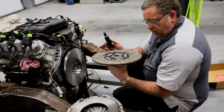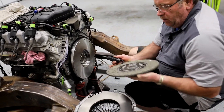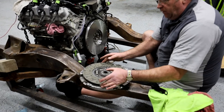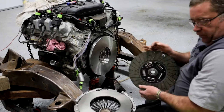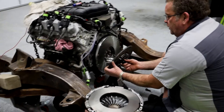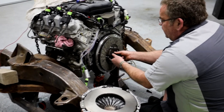This particular clutch does not have a marking. We can see that this clutch will fit in the pressure plate but will not fit in the flywheel. So we know that it has to go this direction. Typically that's the direction they go anyway — springs out — but I like to check them.